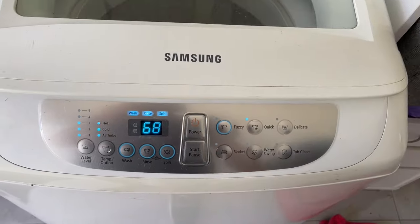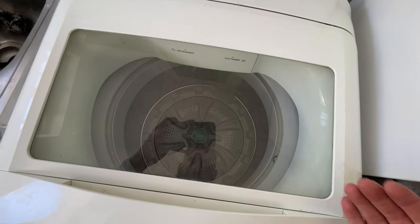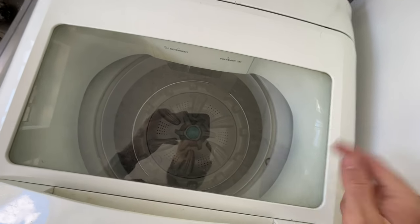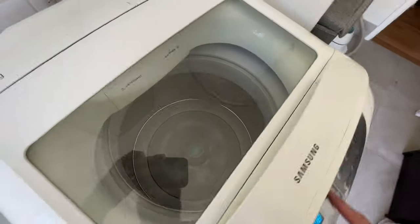Let's put it back up, power it back on and we'll go for a spin. That's the pump. Fixed the washing machine — feel pretty good about myself. I'm going to give it a good full clean because it's looking a bit messy. It was a cheap secondhand unit but there's no need not to look after it. What you should take away from it is: normally if it is humming, it's normally just something to do with that capacitor — either the capacitor itself has died or the connection between the capacitor and the motor.